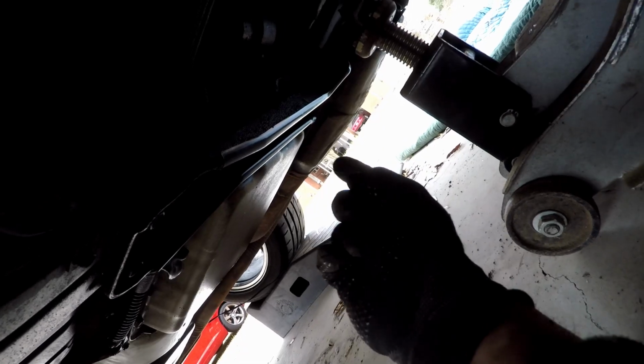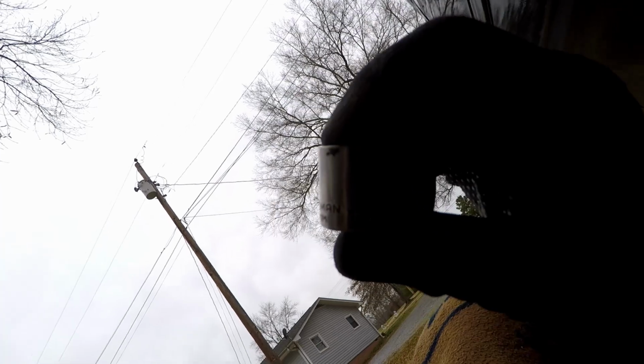It's not that many. It's very simple to do, but you do have to get the car up off the ground. All right, here we are under the car. I got another jack because you're going to have to put some support underneath the transmission to take the weight off of the crossmember. But there's two bolts here. There's two bolts on the other side, and there's one directly in the middle. That takes off the transmission crossmember. Then there's two bolts in the actual mount, and I don't know what size they are yet. It looks like either a 10, 11, or a 12. I'll let you know when I get there. But these right here are 15 millimeters. I hope you can see that. But they're 15 millimeters.